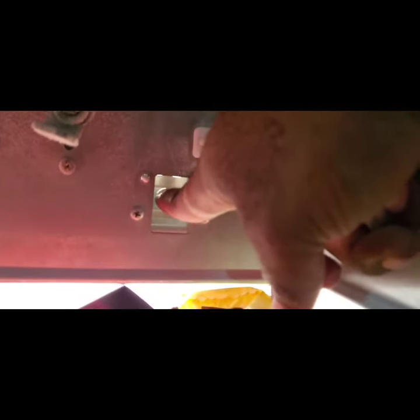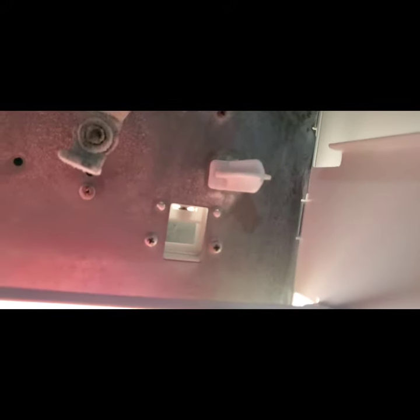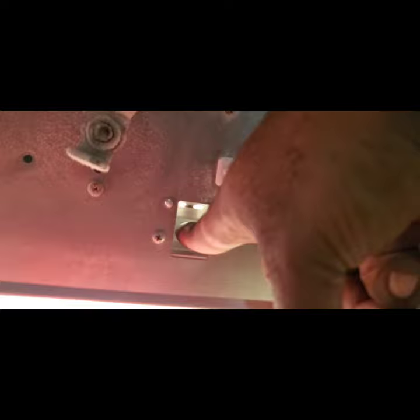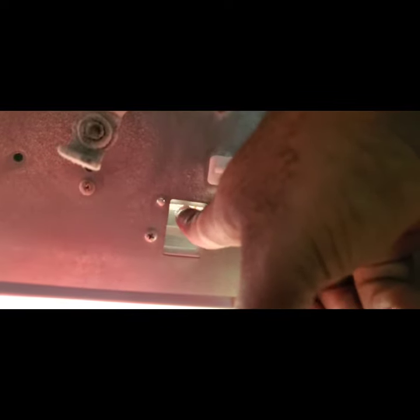This is frozen. Somehow ice got back there — moisture got back down onto the middle spring — and through whatever cycle of defrost and re-freezing, the spring froze up. So this isn't moving up anymore, it isn't springing up anymore. And for some reason, with it stuck down, it's set for crushed ice.